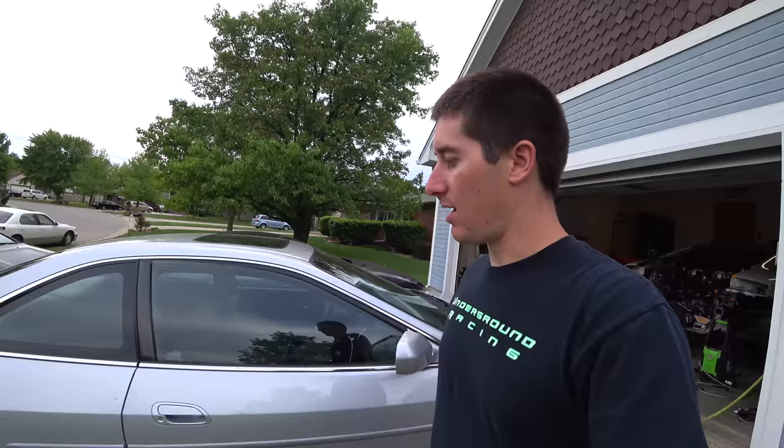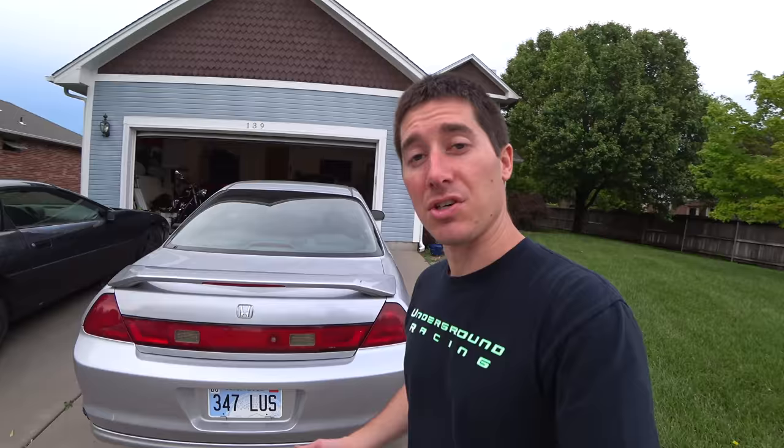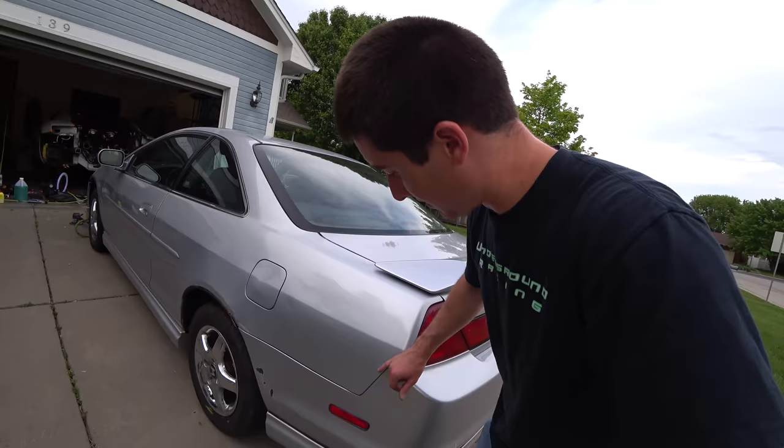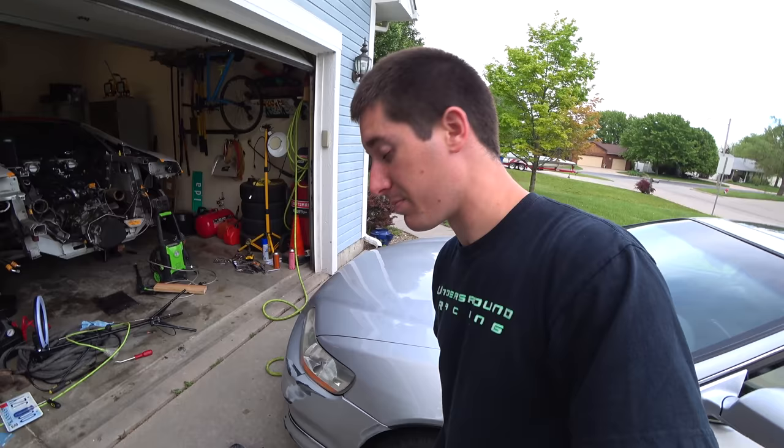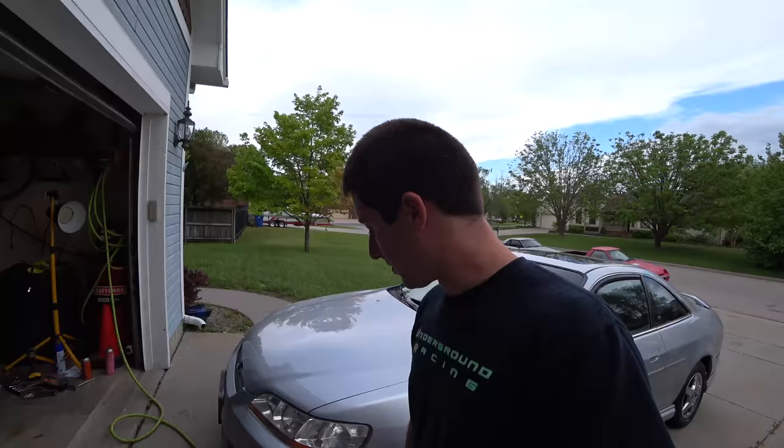Get the bumper done - I bought a newspaper so we can use it for masking. I want to hit the rust spots, that would be awesome so I could stop the rust. I've got rust converter too, some CRC rust converter that might help. I need to sand this, this one's rough right here. I did just reattach the bumper - we pulled it off, put these clips back in, put the screws back where they belong. I had to pull this clip and this one doesn't hold exactly like it's supposed to, but this clip is screwed back in where it belongs.